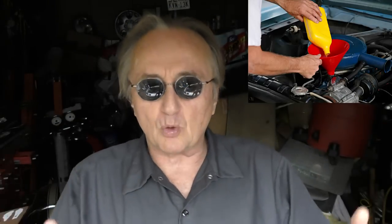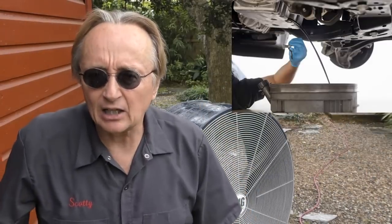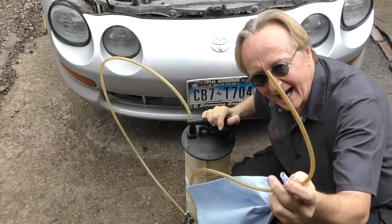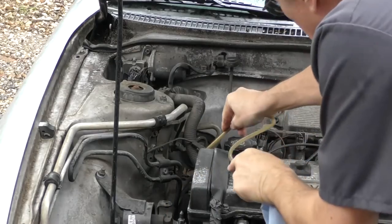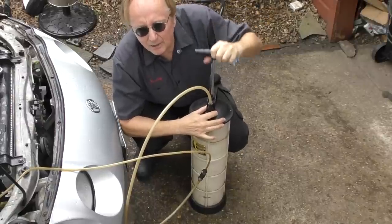The best thing to do is find out exactly how much oil your car takes with an oil and filter change. If you do it yourself, put in the right amount — if it says 5.4 quarts, put in 5.4 quarts. If there's too much oil in, just get a clean drain pan, take the drain plug off, empty it out, and pour the correct amount back in. Or if you're mechanically inclined, you can use a vacuum pump — just stick it into the oil dipstick hole and suck the excess oil right out of the engine.